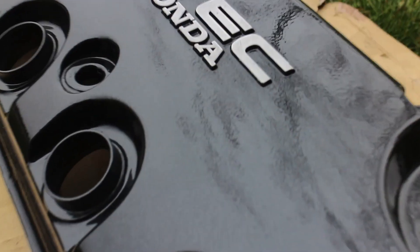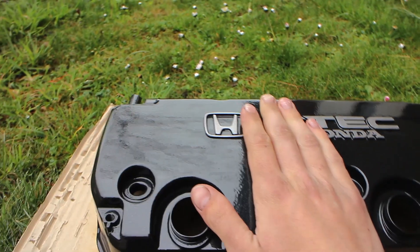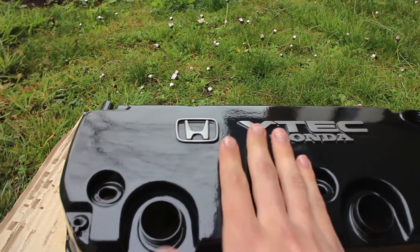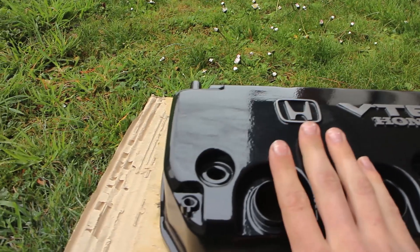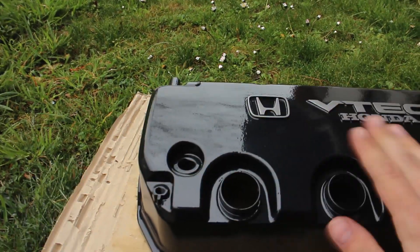I hope you can see the sparkle. So this thing is done. What I did was after it was painted, sanded out the runs, used 2K two-component clear coat - clear coated everything so it's rock solid. Don't use the regular clear coat, that stuff never hardens, it's not good. But this is solid - it will never scratch, so it's pretty much perfect.